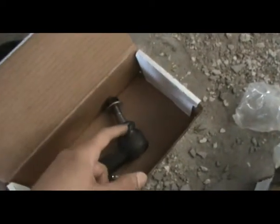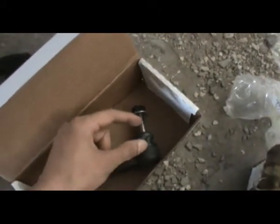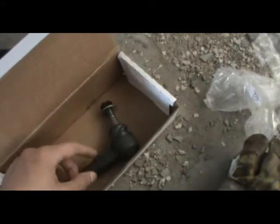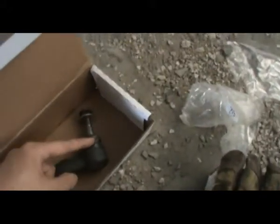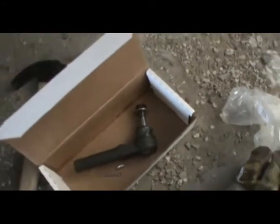Because these are really cheap ones, I don't want the greased type. I hate the greased tie rods. There are ones with a full rubber ball that do not require grease — that's the best thing to get. That was actually the original part that came with the car when we bought it. But when it broke, they gave me this type and I put it in — it just doesn't last. This little rubber thing ruptures so fast and you have to change it again. It's cheap at $25. I'm going to invest next time in the one that does not require grease — I highly recommend it, otherwise you're going to be changing this thing a lot.